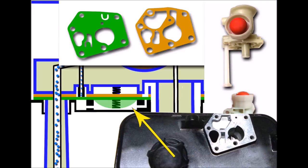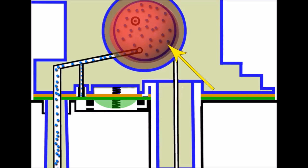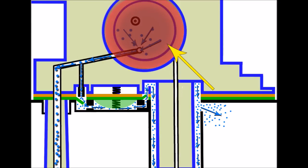This cross-sectional view of this compartment is what we're looking down on. Imagining that this carburettor has never been used, there would be air behind the primer bulb - those little blue dots represent air just sitting there. Now let's look at what it looks like when we press the primer bulb. Immediately we can see the blue arrows representing air being pushed out into that little tube and out from behind the primer bulb. There's a hole here too and some air may go down there, but because this is the path of least resistance and the biggest hole, most of the air will go this way.